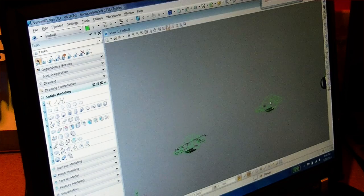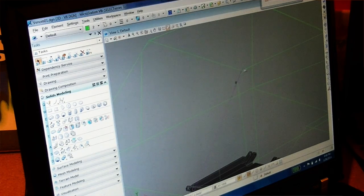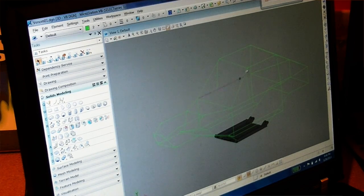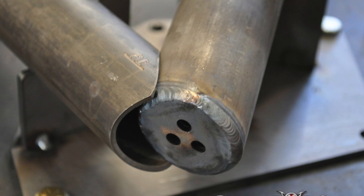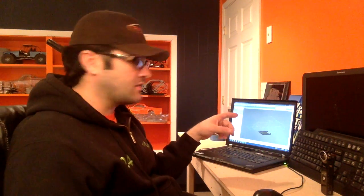Going a little further, I've removed those control points and started to add some radiuses for which tubes I'm going to have bent. In the real Poison Spider truck there aren't a lot of bent parts, and a lot of that influence comes from desert racing. In many desert trucks you'll see very few or zero bent tubes. The reason is that as you bend them, even with a mandrel, the tube has to shrink and stretch on opposite sides, making it less strong. So they use mitered cuts, weld a little bolt head inside the end of those miters, and weld those two pieces together to get maximum strength. Poison Spider did that exact same thing.